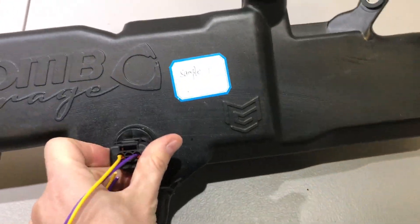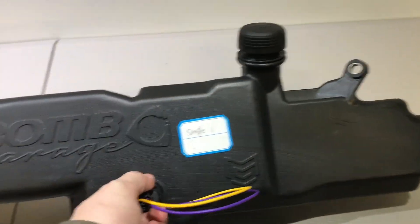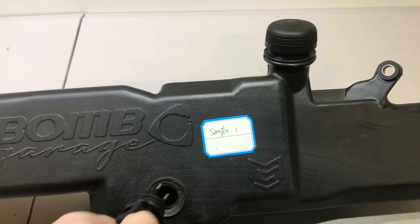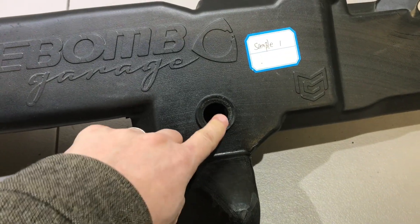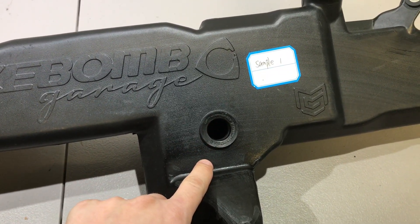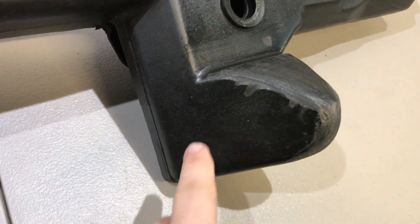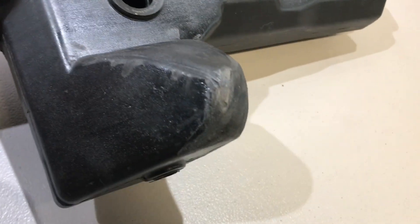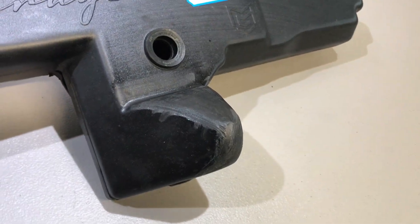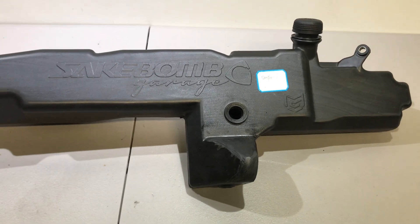You can see there's a cool little pigtail as well — that would be your fluid level sensor. One comment about this fluid level sensor: we're actually going to move it on the production version, just move it down a little bit further so it clears the interior panels a little bit better. We're also going to add a pickup right here because we discovered we have the room for it, and that might be ideal. We're also going to add a little divot right in the middle of each boss that will act as a drill guide so you'll be able to center that drill bit really well.